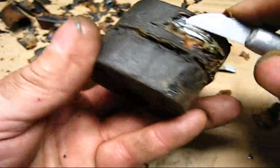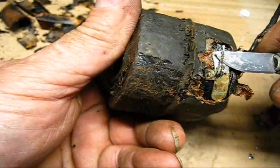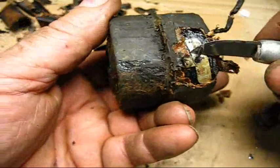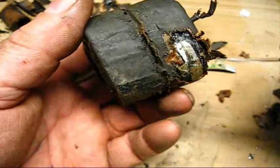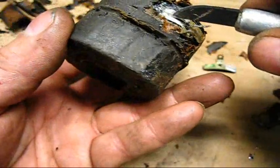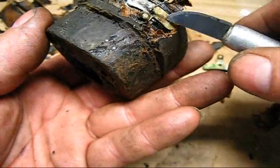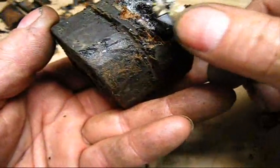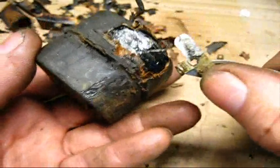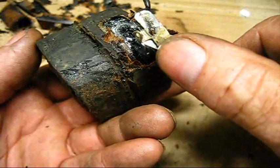You see that, where that's soldered on there? It's really corroded. That was not a good solder — you've seen it come loose, it was not making contact. Just such little trivial things as that could be the problem. I'm just bringing this to your attention as the possibilities.